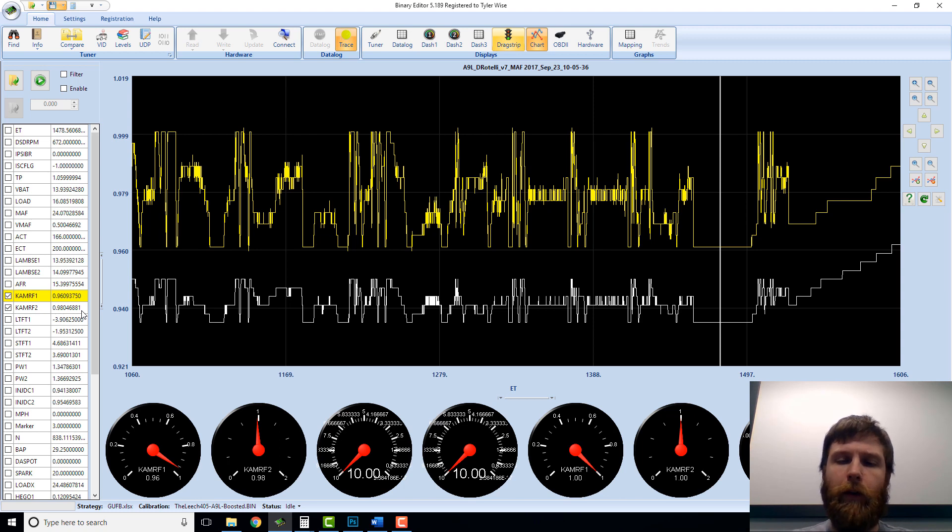And honestly, if you're doing something like adding a turbo, you probably don't want to put your wideband in either side anyway. You should actually put it somewhere in the downpipe after the turbo, so you've combined the gases from both sides, gone through the turbo, and on your way out to the exhaust from there — that's a better spot to measure because you're averaging everything across both banks and getting a better measurement. So this was a quick one tonight. Appreciate you guys, and like always, we'll have more. Good luck.